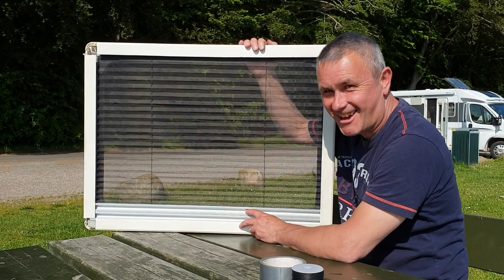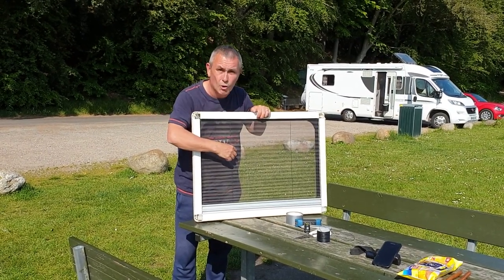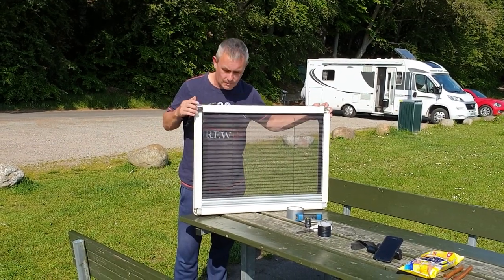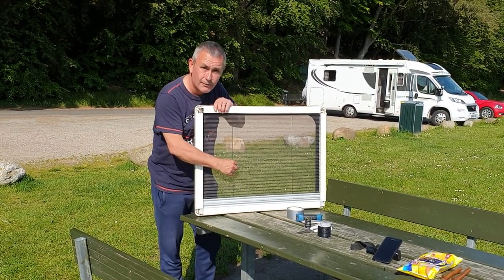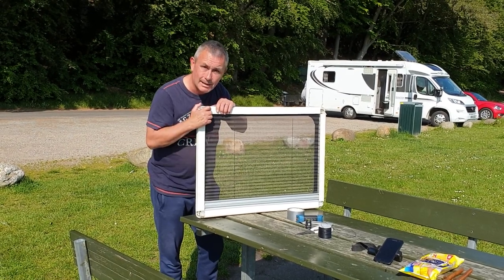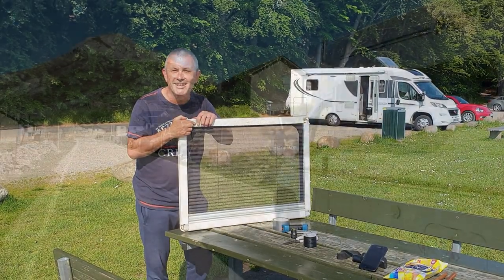Are you ready? Watch. So in summary, if you need to repair this blind because the cord's gone, what you need to do is remove it from the wall — four screws, dead easy. Then take the caps off — there are four screws on the top and the bottom. Remove those and it just pulls apart. Then carefully replace the cord exactly how the old cord was wrapped, tighten it all up, put it back, screw it all back in, and it works! I hope that's been helpful. It's a very warm day and it's now time for a cold beer — see you later!